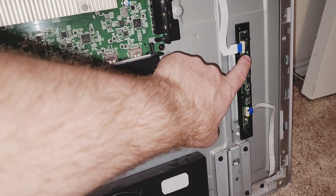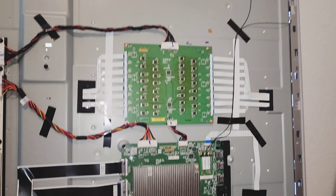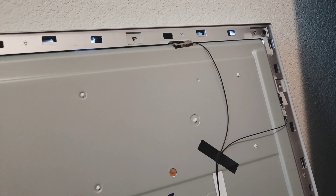I plugged it in and the light came on down here and then faded away. Let's go ahead and hit the power button. We got light — see the light around the edges? That means the screen's on. So we know this power supply is good — we have a backlight lit up, the TV's on. Somebody must have broke the screen while moving it. If you have any questions, just leave them in the comments. And if you want to connect with me, I have a public group on MeWe called ShareYourTrade and I have an Instagram. I'll leave links in the description for both of those. Thanks for watching.